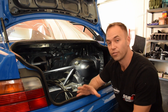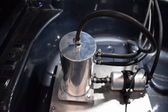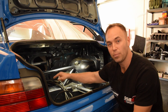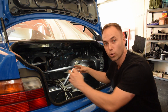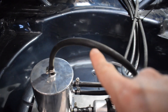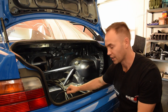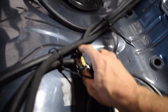Now we move to the back of the car where I have the fuel surge system installed. On the left we have the fuel surge tank — this is a 1.5-litre fuel tank. What happens is the pump from the left-hand side and the right-hand side of the inboard fuel tank pumps fuel via two lines into the fuel surge tank to fill it up. It then has a return at the top so that if it's full, the fuel returns back into the fuel tank.